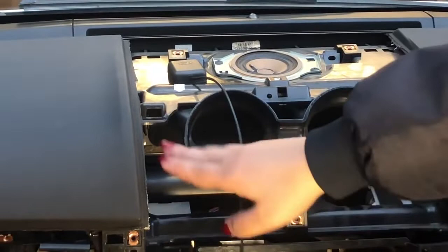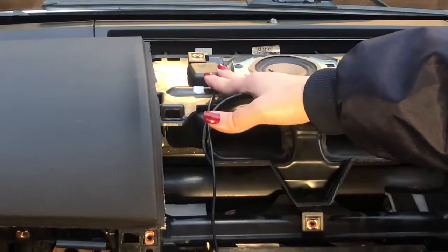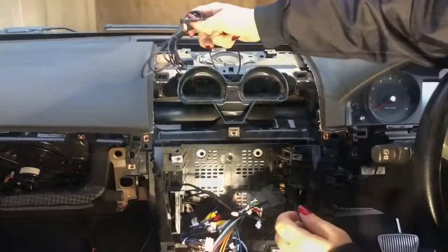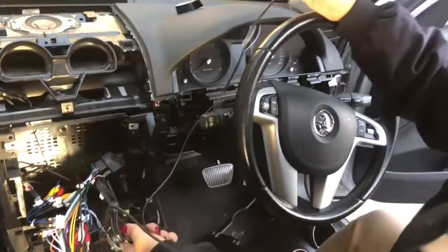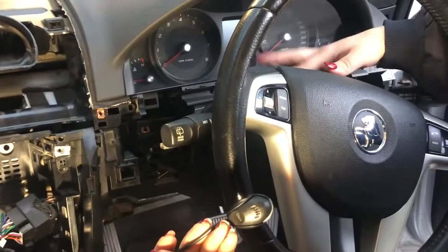Leave the connections here so we can connect the back of the unit. For the GPS antenna, attach it somewhere on a metal surface. Try not to put it all the way underneath or hidden under several layers of metal and plastic, as it won't pick up GPS signals. Try not to put it close to the speaker either. We've rested it there and picked up an okay GPS signal — if you can find somewhere better that's great, but this position should be fine too.